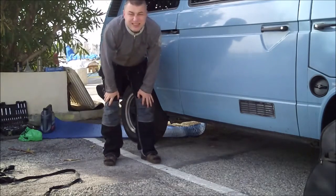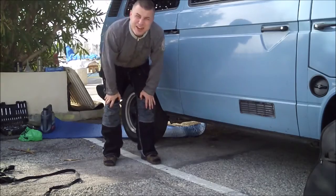Make sure you lay something under the car in case it drips. Right now there is about 4.4 liters of oil in my engine and I need a can for at least 5 liters. When you are doing this, go really slowly, because you don't want to drip on the asphalt unnecessarily. Try to aim and hit.